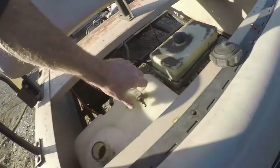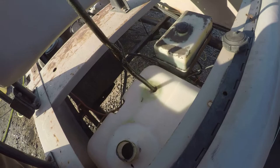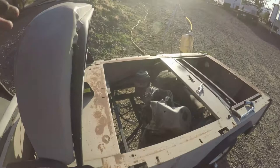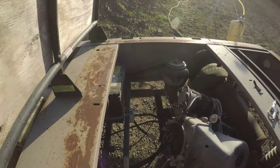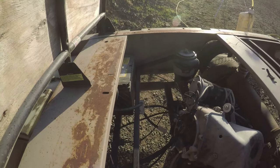Why is it working? How long has this poor thing been sitting? Look at that — well, let's go make a new one. Got a new pickup tube — temporary, I should say. The filter was so bad, the original one in there, we couldn't even reuse it. So I just have a nut zip-tied to the end of the new pickup tube, and we're going to rely on the inline filter for the moment.